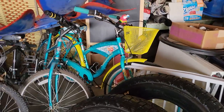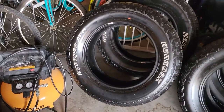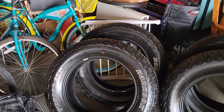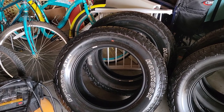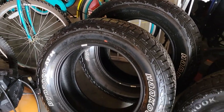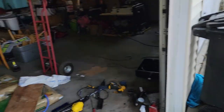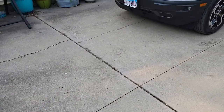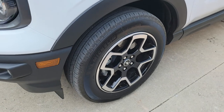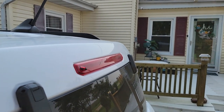The stock tires are 225/60R18s — about nine and a half inches wide. The new tires are 265/60R18s, which are about ten and a half inches wide, and the tire diameter goes from 28.5 inches to 30.5 inches, so we're gaining two inches of height and an inch of footprint. They also have a more aggressive tread pattern, which will help out here in the country getting through snow and drifts.